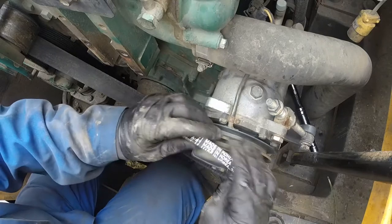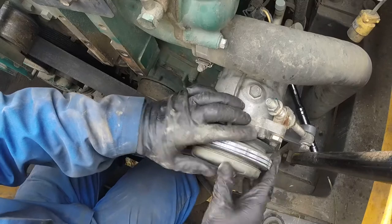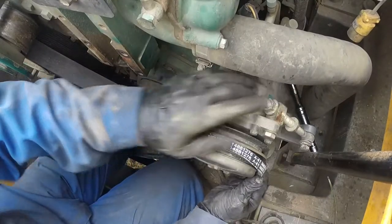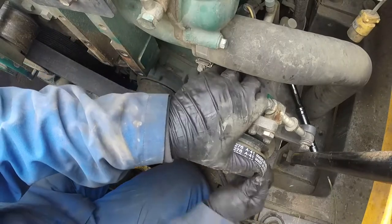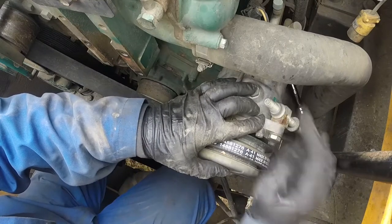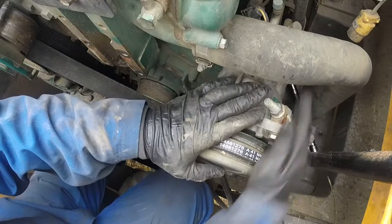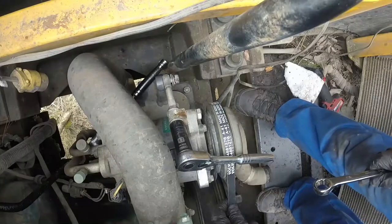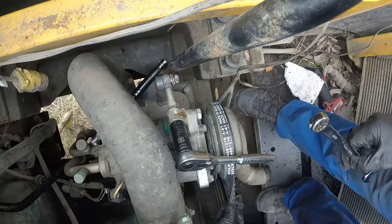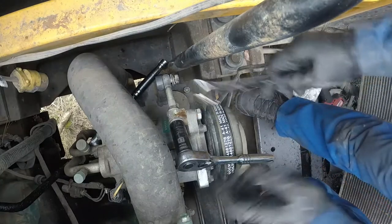Okay, place the new belt. We got that from Volvo. They're not expensive, but then you don't need to worry about the belt for some time. And in most cases, breakdowns and issues are human error, because you don't watch, don't maintain, and you miss the point when you can prevent it. Anyway, we all make mistakes. All right, now we need to set the tension on the belt.